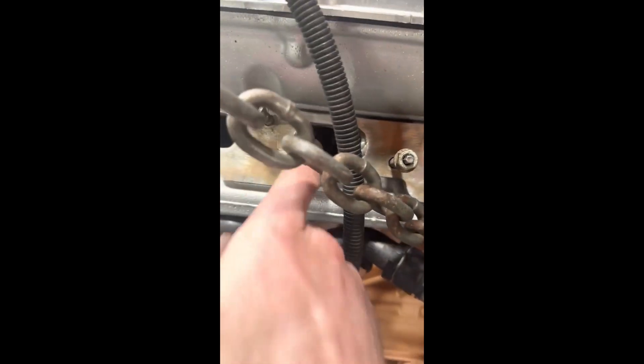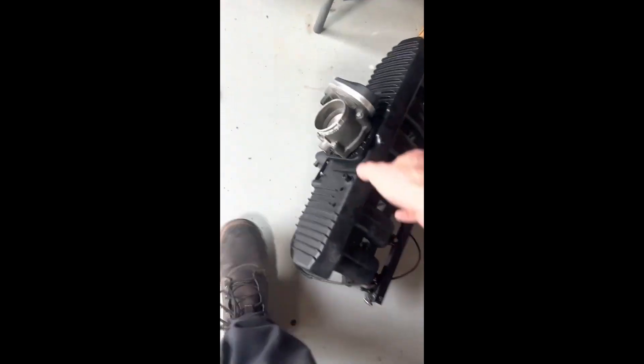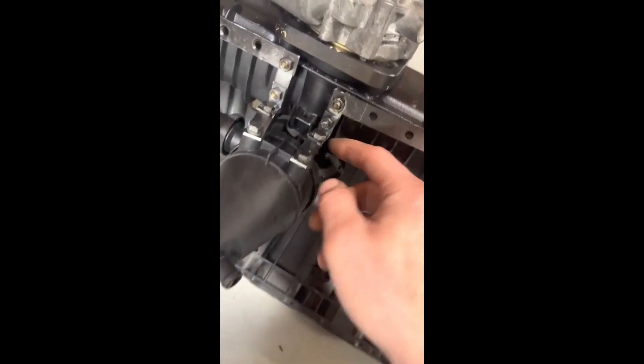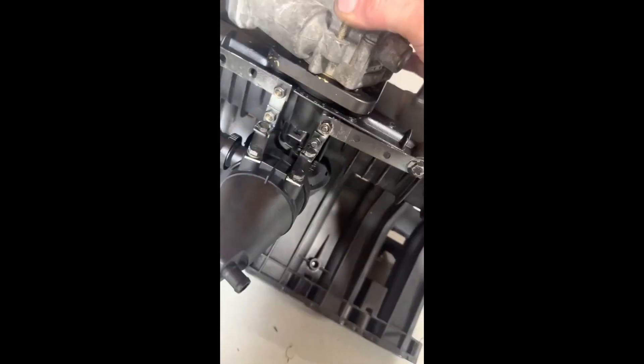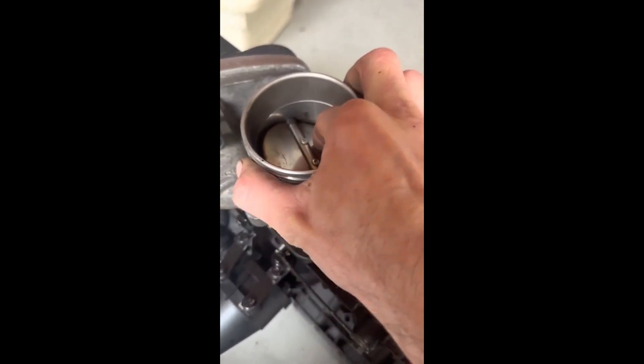Just to touch on my M50 manifold — here's the actual port adapter, you can see it transitions the port rather smoothly. I used studs from an N54 since they're longer. Here's the actual M50 manifold — you can see the bracketry going on, and that slips right into where the stock idle control valve hose would go. I'm not using the control valve since this has an electronic throttle body. You can tune the M54 to control the idle with the electronic throttle body.